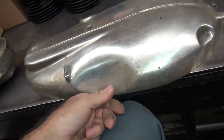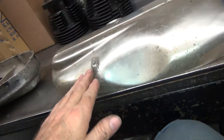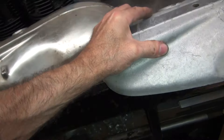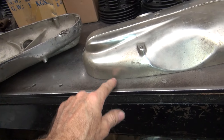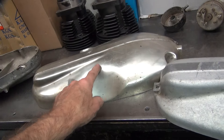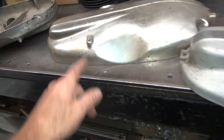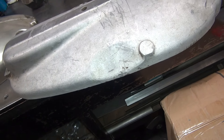Now these are the KH covers. This one here has a show polish finish on it — you can see it doesn't look like this. Also you can see the difference in height through here versus this one. See how tall that is — it's short here but taller here. See how short this one is, see how tall this one is. The hump's a lot bigger also, because this whole surface here is taller than this one, so the chest is more flat, and this one drops down more. They also have the level plug right here. This one had something over here but it's never drilled, so I'm not sure what that was for — they didn't have a level plug.